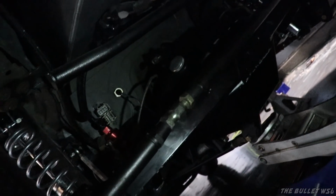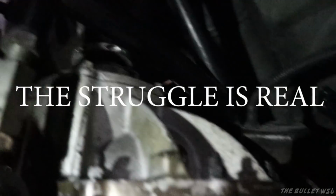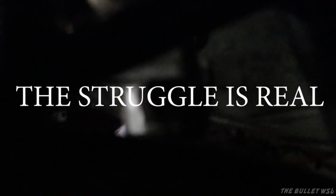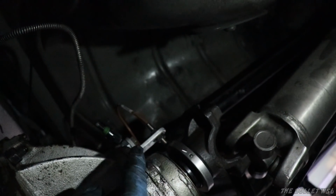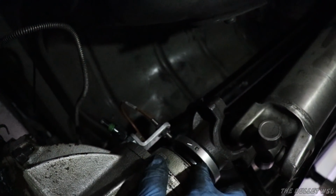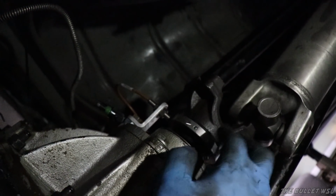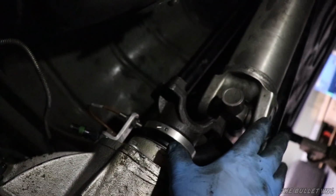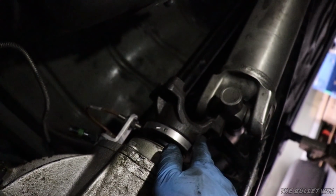All right, so we got everything just about pretty much wrapped up. We had the rear end out, I went ahead and added this collar, sensor collar and sensor for drive shaft speed. So we can data log miles per hour. Go ahead and measure converter slip when we add the front wheel sensor. I'll also use it for traction control.